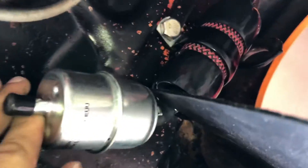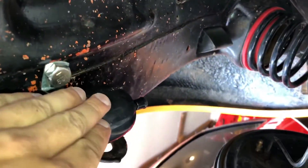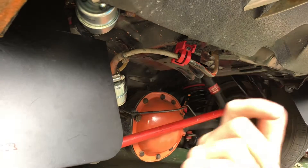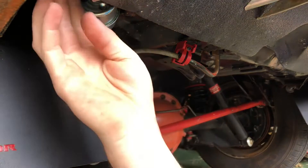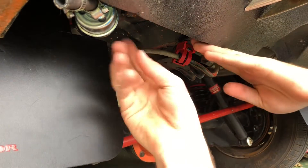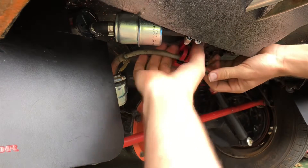You can see we have our fuel filter here and we're going to have to connect it to the factory metal line right here. I'll probably cut it right here and put a little rubber add-on. I left enough slack when I replaced my plastic fuel line to route it over without any extra line. I'm going to try and cut this metal fuel line now — when I cut through it it's going to spew fuel everywhere, so I'm going to get the hose on it as quickly as possible. Let me make sure my hose is long enough for where I'm cutting, and it is, so let's continue cutting.